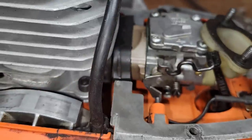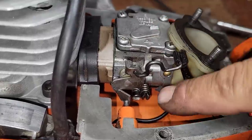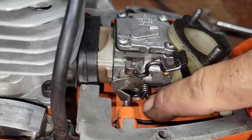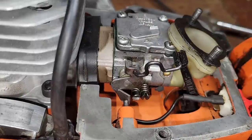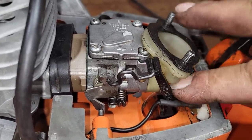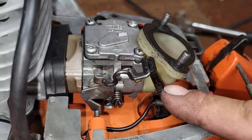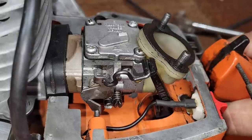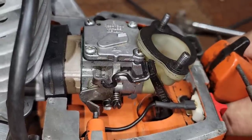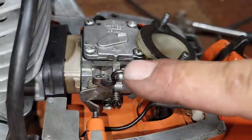off the cylinder. And then, friends, the cylinder bolts, see how there's four screws here? Well, these Tillys have four screws on the bottom. Those bolts start hitting once you drop the cylinder too much. So now you're filing the bolts down, or the screws on the bottom, so they don't hit. Then this air horn, friends, you end up having to grind this down. And then this throttle linkage here will end up hitting your air horn, right? This one's just barely touching, but that's fine because we're at idle, right? It won't go back any farther. And then your air filter starts rubbing on this really bad. So now you're heating this and bending it and making a new linkage.